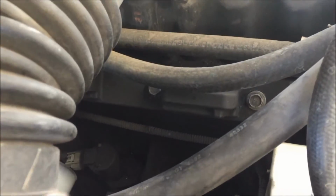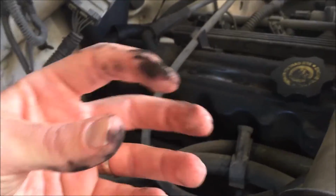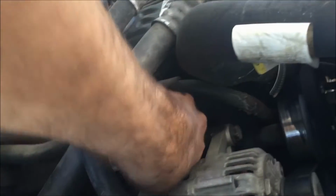Okay, so there's actually only 4 bolts to loosen, and they're very dirty. I don't want any of that dirt to get in the engine, so I am going to get some baby wipes to clean some of this carbon off. Gravedigger's back, and he's got baby wipes. Clean this gunk off. Better on the baby wipe than inside your engine.